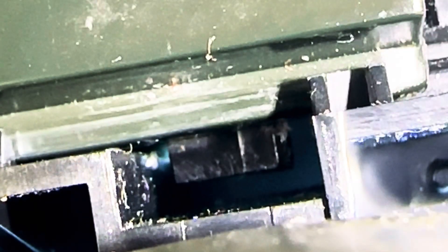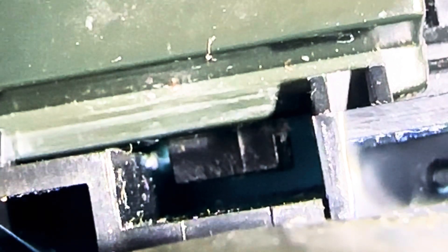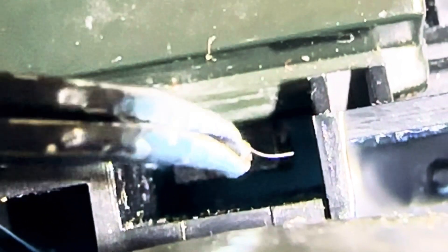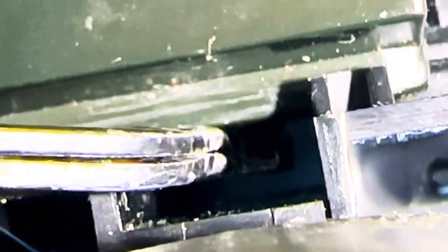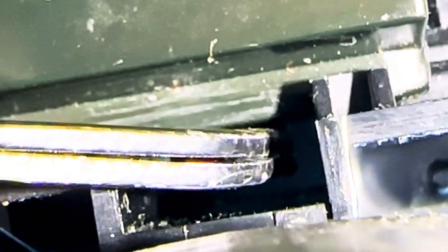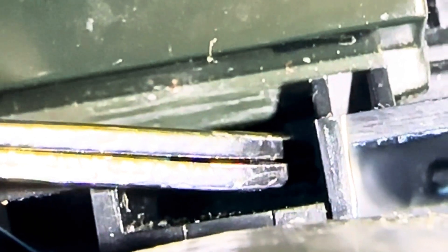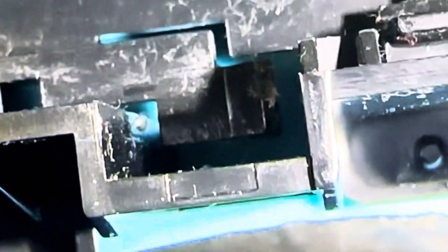On the Samsung drive, you will see two release clips on each side of the disk tray. They are slightly below the disk tray itself, in these two little rectangular compartments. What you want to do is take a pair of tweezers or a screwdriver and push down on the clip. While holding down, you slide the tray out. You need to do this twice, once on each side. Once the tray starts to move, it should stay in position so you can move to the second side and do the same thing. Once both have been pushed down, the tray slides right out.